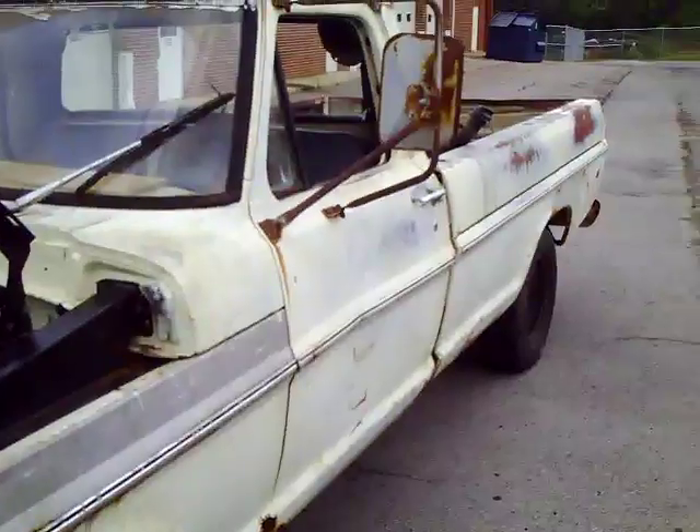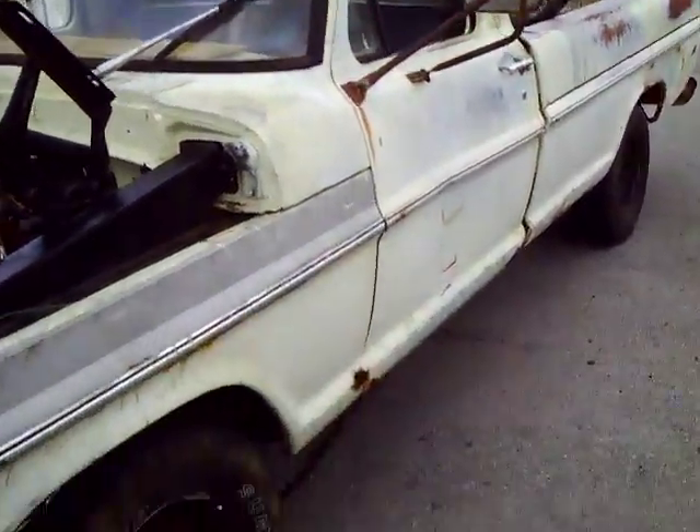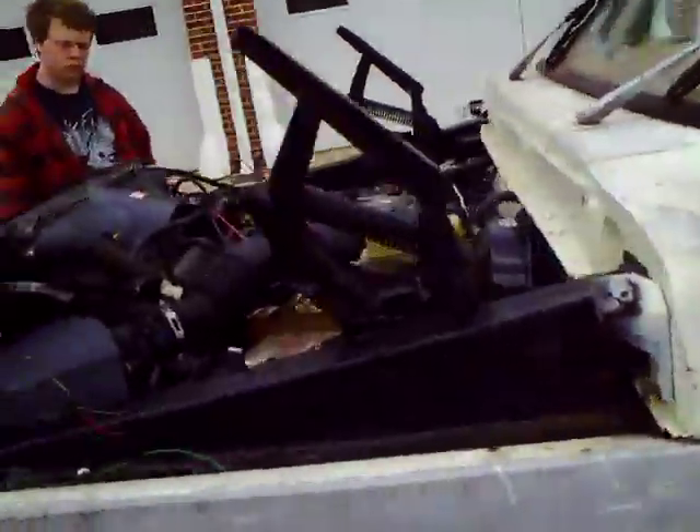I can't really drive it very safely, but I'm just going to show y'all that it does run now and it does move. We've got the drive shaft made — let's see if I can get a shot of that. That drive shaft is pretty. We got that made in Rossville, Georgia, close to Chattanooga, Tennessee. The drive shaft had to be 77 inches long to replace the two-piece drive shaft it had originally.